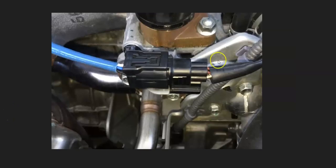The next thing to do is check the wiring thoroughly — be sure everything's plugged in and there are no open shorts or anything like that. Keep in mind that anything wrong with the wiring is going to cause the same symptoms as a bad sensor, so you want to check that out. Also keep in mind these are usually on a fuse and sometimes a relay. For example, here's a 2005 Toyota Tacoma — this AF heater fuse is the fuse for these sensors, and there's also an AF heater relay right here. If something went wrong with these, it will cause issues, so keep that in mind.